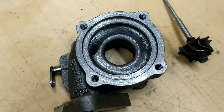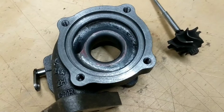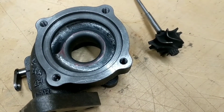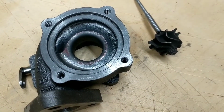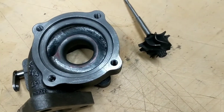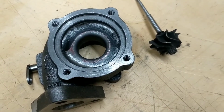Hopefully this will reduce back pressure. It's making plenty of boost — way more boost than I need. Reducing the back pressure should basically let it rev on up. I've probably effectively bought the AR of this turbine housing up higher than it was, even though I haven't changed the wheel. I've increased the flow, and reducing back pressure is always a good thing on a turbo.